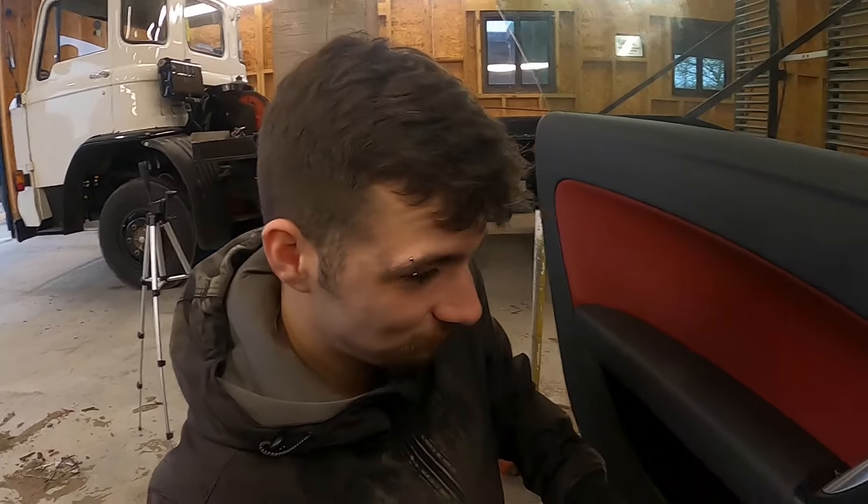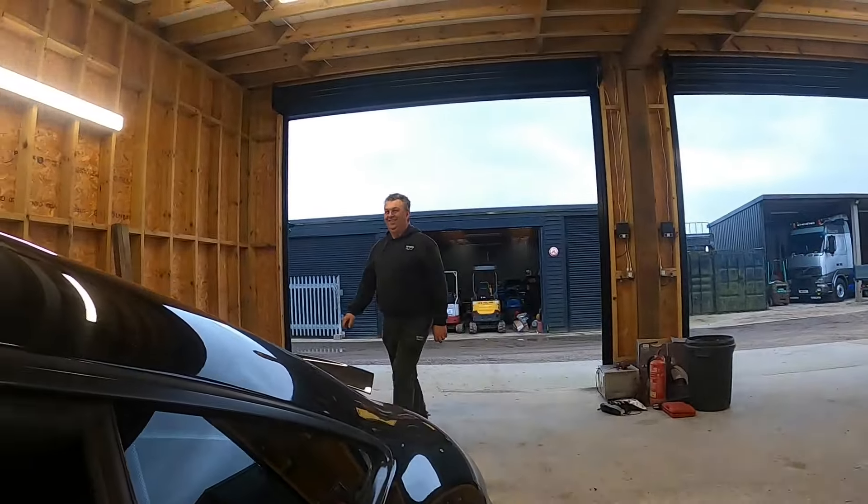The previous owner of this car — we're constantly finding things. We found issues before with the rear tail lights where someone had earthed out the connector and rather than put new tail lights on, they just bridged it, so it was burning a hole in the back of the tail light, making them all smoky. That's the thing with second-hand cars, you're always finding stuff.